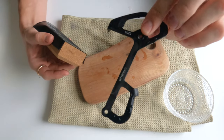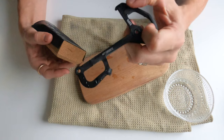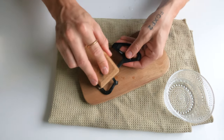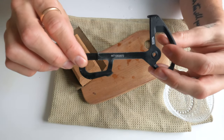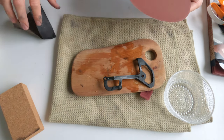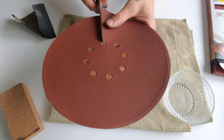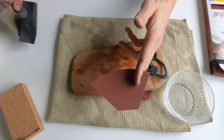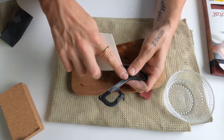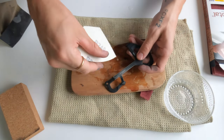What do you think about bikes that have this sort of finishing on the frame? I think Trek and YT Industries did a bike with that sort of paint job — just looking like old. Isn't that like buying those pants with holes in them? Patience is probably key right here. I feel like that 600 paper is way too fine for just getting rid of the initial paint. So I have this 240 grit — it's a bit heavy, but I think it's going to be faster to remove the paint with this. There are also ways to remove paint without grinding, but I think it can be nice to grind it down a bit because then you can chamfer the edges as well. Let's see if we can make something happen with the 240 paper.